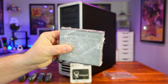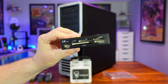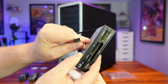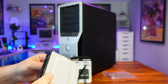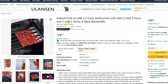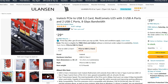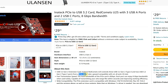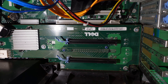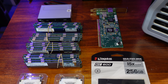Lastly, I've got this 3.5 inch media solution which will fit neatly in the floppy drive bay at the front of the machine. These were all the rage around the time that this machine was built, as more and more people moved away from floppy disks and towards flash media of various standards. Terrible Chinese screen printed fonts aside, these are actually really useful, and seeing as it just needs a USB header on the motherboard to connect it to the system, it's a dead easy upgrade to boot. I did also want to include a PCI Express USB 3 card, but it turns out these all require PCI Express 2-based slots as a minimum, and the slots in my machine are the original implementation of PCI Express, so they won't work, which really irks me. So that's all of the new parts laid out for this machine — time to get on with it.